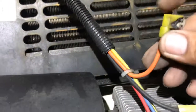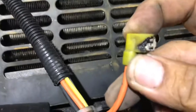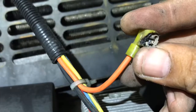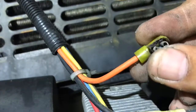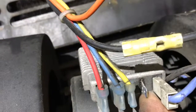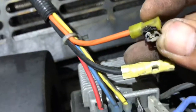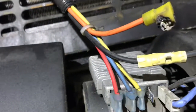As you can see, these little motors start to drag — basically the bushings wear down and they take a little more power just to keep running. What that causes is overheating, and it melts the terminals right off. You can see this is burnt, and of course the connector itself is also burnt. So that's what's causing the issue with this one — we're going to go ahead and replace this little motor.